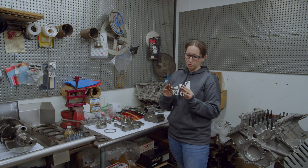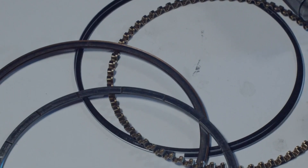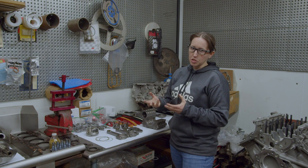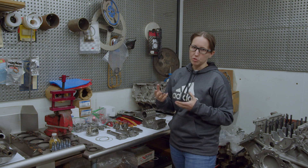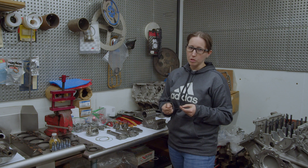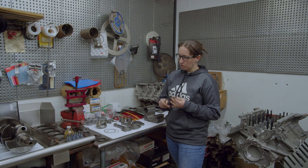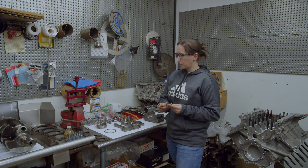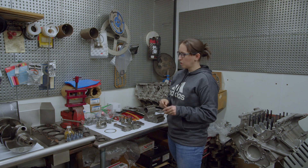We pulled the rings off to figure out what was going on. We tried the new exhaust gas port ring and think it did pretty well. With the piston scuffing, the rings were starting to butt — that was a result of the scuffing, not the cause. You can also read the tune in the ring itself: check the edges to make sure it's not waffling or anything like that. None of it showed signs of bad tuning on our side — we just need to get the piston design right.